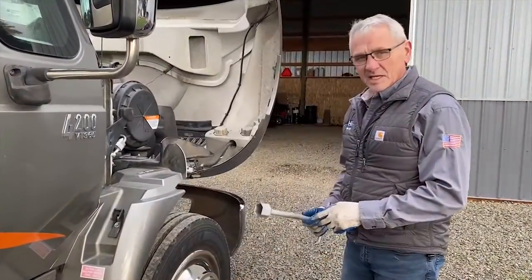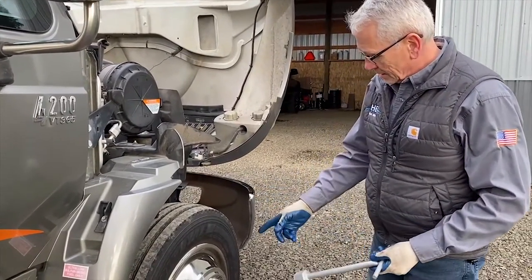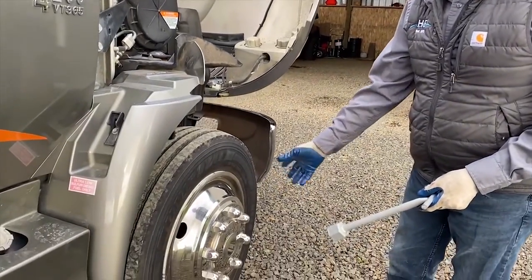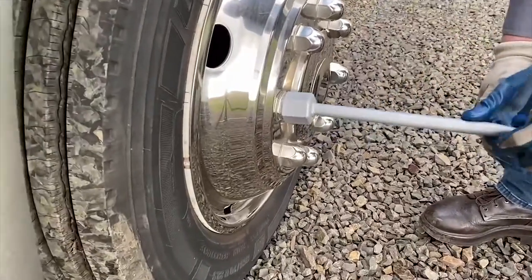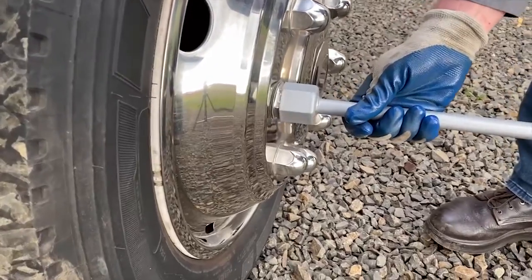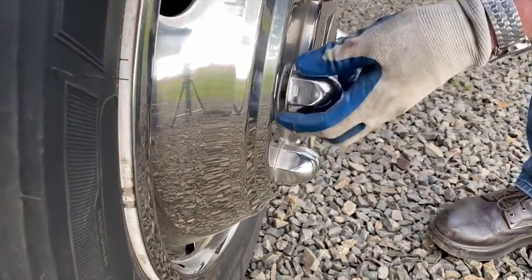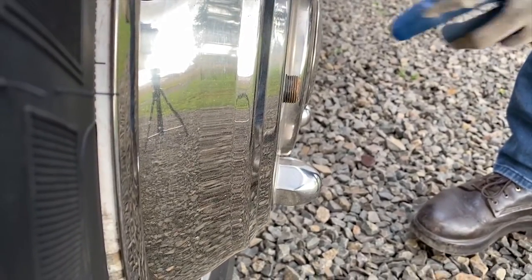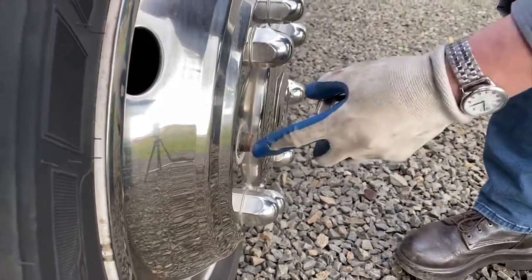The coach actually came with this wrench, and I'm going to take off a front nut here on the wheel cover to show you what it really should look like. See, it's got the indentation right there — pull that back. Now look at how much stud is sticking out there. That's pretty good compared to what we have in the back, which is just a tiny tiny bit.